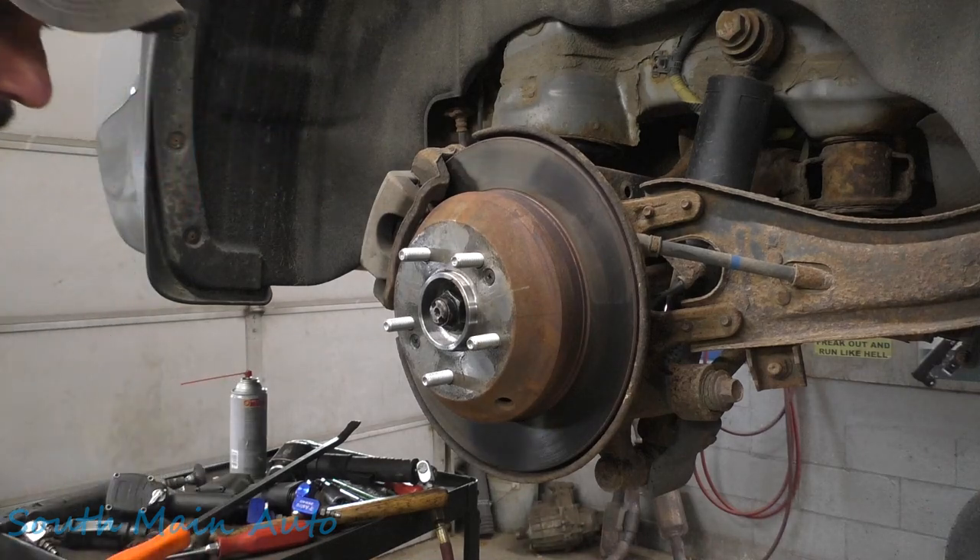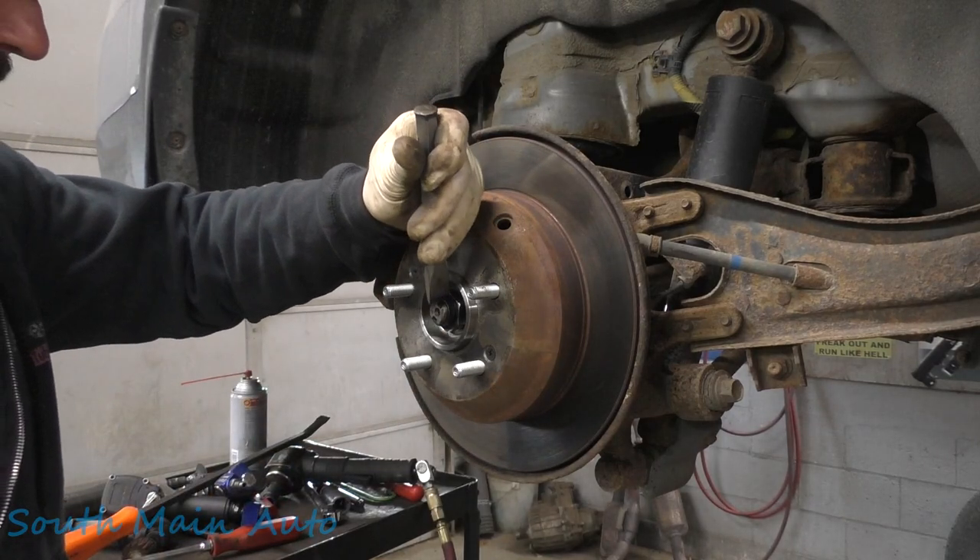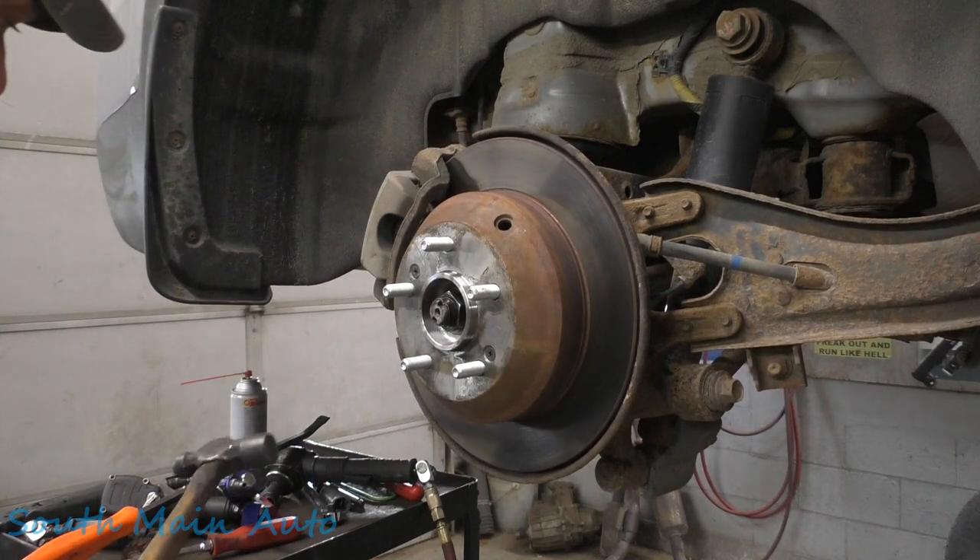Just barely got it — 210 ft-lbs. Give that a smack back in there. There we are folks — throw the wheels on and take it for a shakedown. There you have it folks: wheel bearing on the back of your 2017 Hyundai Santa Fe. Went pretty easily — I know you guys were hoping for a fight and I was too, but there wasn't one. It gave up, threw up the white flag immediately after taking the bolts out, which is kind of unusual here in the PRNY. Nothing more to say other than I'll see you in the comments section — questions, concerns, Instagram, Facebook, you guys know what to do. Just remember viewers: if I can do it, you can do it. Thanks for watching.